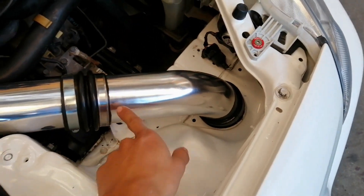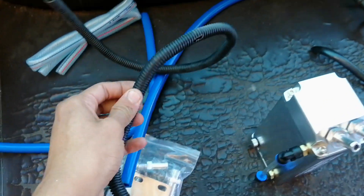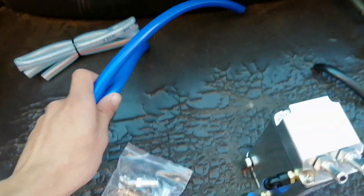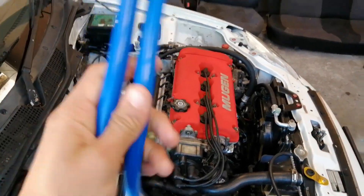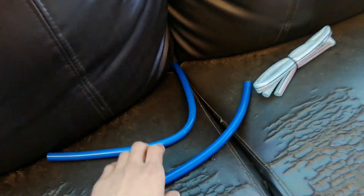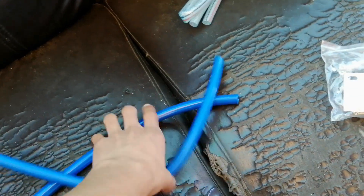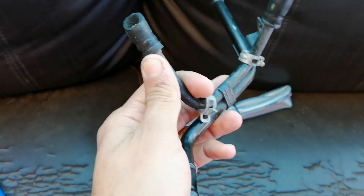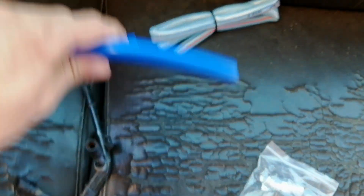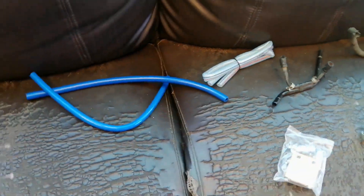I think I'm going to go with option two — running the secondary breather pipe to a filter underneath the car — because I don't want too much piping around the induction. The blue piping I got came with both inductions I bought. I'll be covering the blue piping with a harness sleeve or insulation tape, because I want everything to be black so it's hidden, especially underneath the strut brace. I'll extend the two pipes together using a metal piece and two clamps to get it all tightened up.